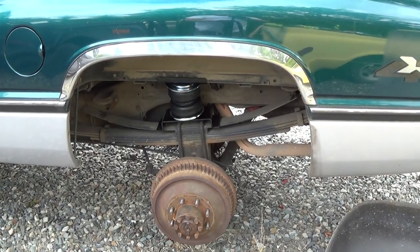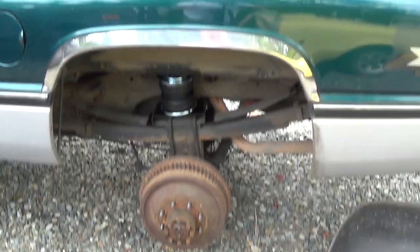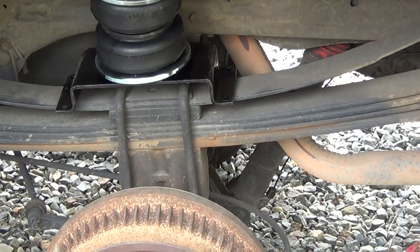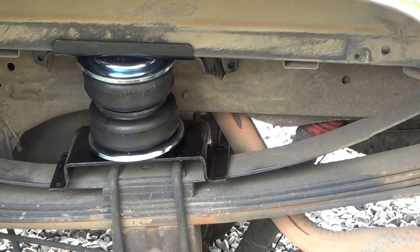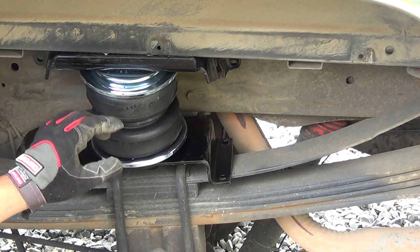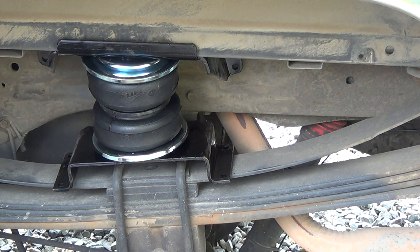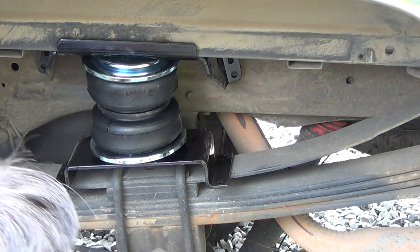I've put the spring — the load lifter — in, and as you can see there are two ways it goes in. One would be as if I didn't have that helper spring, but I do, so it's got to go over the top. There's a little lip on the bracket that rests right over where the hole is for the cover. I'll be putting two in, and I need to measure it to make sure the distance is okay and level it up a little bit.